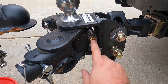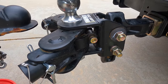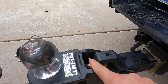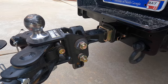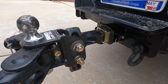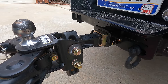You can adjust how much sway control you have with this little hex nut right here. I haven't had to adjust it at all — I live in Georgia, so no icy conditions. You can also adjust your distribution back here with this nut, and everything locks in up front. One con: I don't think they offer a two-and-a-half-inch hitch, so I had to use an adapter — that always gets on my nerves a little bit. But not that big of a deal.